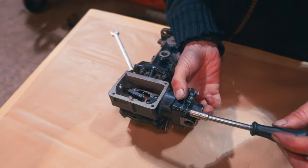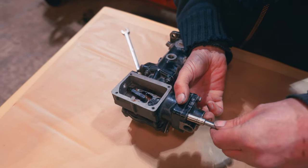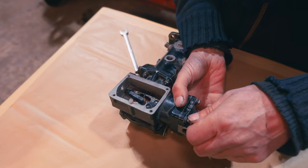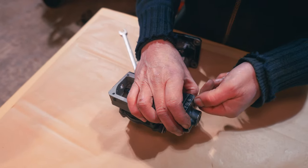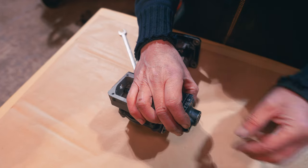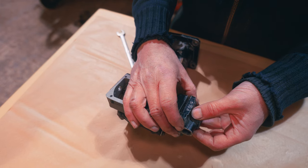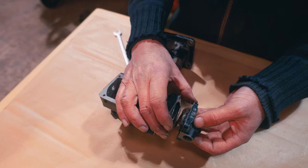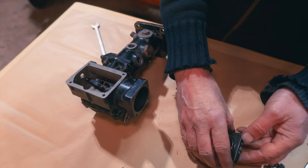This does everything. So a good seal on all of this lot is imperative. Otherwise, you're not going to do what it wants to do. You're not going to get it behaving properly. And this is what goes wrong with these systems, is if you have a misfire down to a fouled spark plug or a condenser breaking down, that type of thing, then of course it'll affect the manifold vacuum, and that'll upset it and it won't run properly, will it?